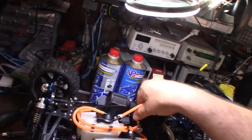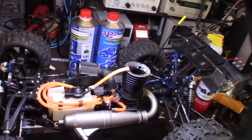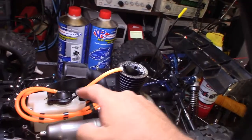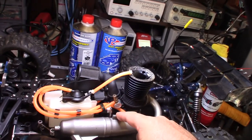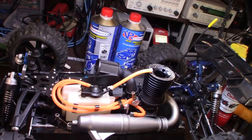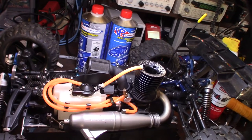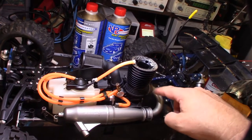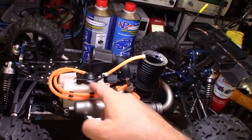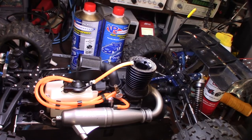There's actually been a lot of debate online about the exhaust length — not from the carburetor to the fuel tank, but from the exhaust to the actual fuel tank. The theory behind it is it's supposed to be like a pulsation damper. As this thing is running, you get high-pressure pulses, and that's what pressurizes the fuel tank to push the fuel back into the carburetor.